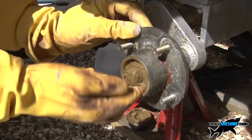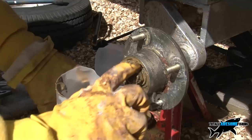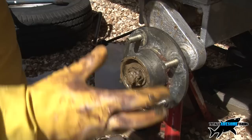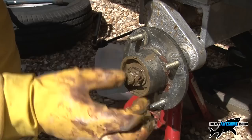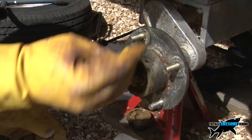I'm going to use the wife's best washing up gloves for this — she'll be well pleased! Get yourself some gloves and get all that gunk out and wipe it in there. Now, just as a tip: if the grease goes emulsified — that's when you've been on a long trail and you put new grease in, the hub gets hot. Then as you immerse the trailer in the water, the hub is so hot and the salt water is so cold that it sucks the sea water in, creating a vacuum. So you do need to check it, and if you're launching after a long run, just let those hubs cool down a bit before you drop it in the water. That's tough to do because we all want to go fishing.